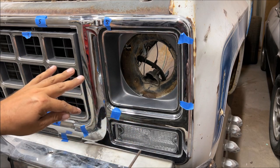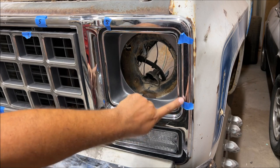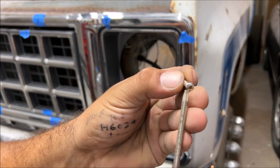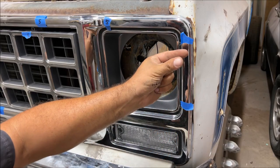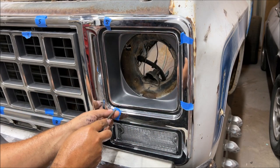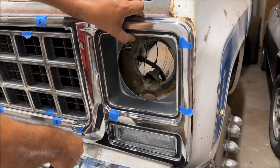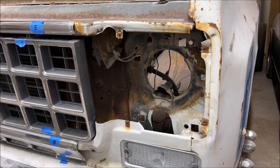Notice on this piece we have five places where the screws are. Mine is a 1980 so your stuff might be a little different, but the screws are one inch long chrome plated small head T15. These have a little speed nut clip that slides over, so be prepared for these things to free spin — they can be very, very difficult to get out. I take all this stuff out by hand because if you put power tools on there you're likely to bust it instantly. Hopefully yours are not stripped.